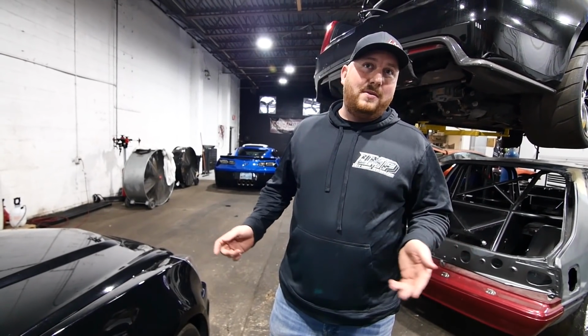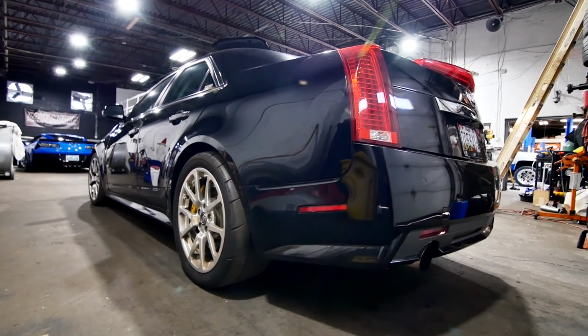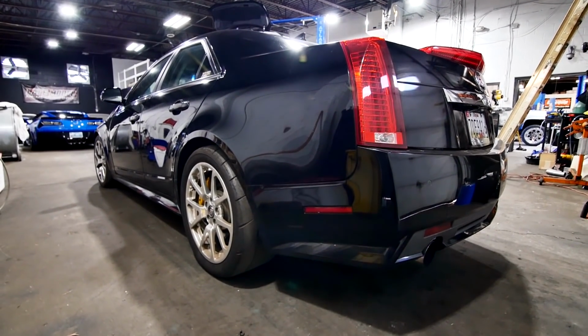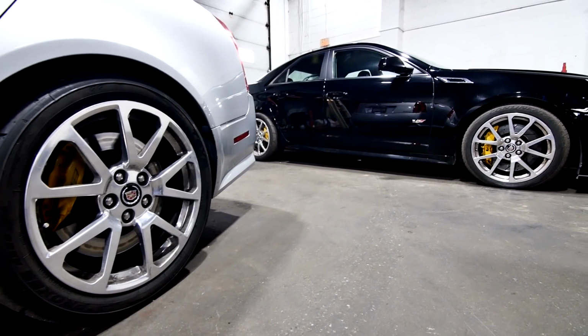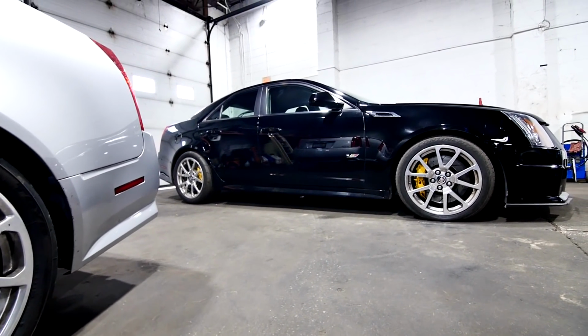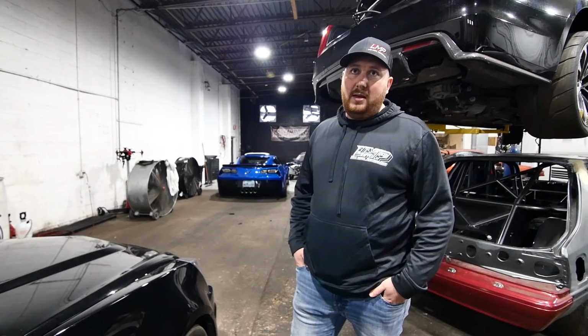Everyone says, oh, the 2650 cars shine on the hub dyno. They're going to a little bit because there's no wheel spin and these things make so much torque. I think this thing's just under 1,100 foot-pounds of torque on the Dynojet. The hub always makes weird torque. It was probably 9-something. This thing pulls to like 8,000 RPM.